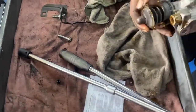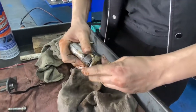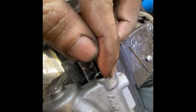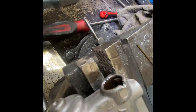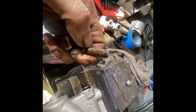How dirty that fluid is! Alright, I got it out. I cut a notch right here to get the seat clipped out — this thing is a bitch to get out; use a really small flathead. Put your hand right here so the whole thing doesn't fall out. Use a really tiny Allen in the hole right here and hammer it to push it right out. You definitely need to do a flush.